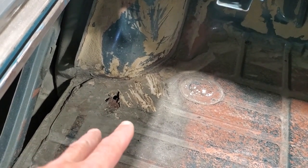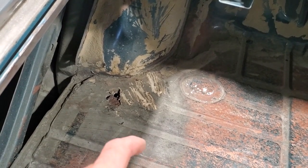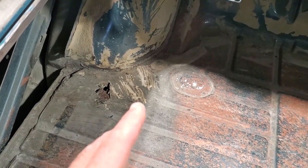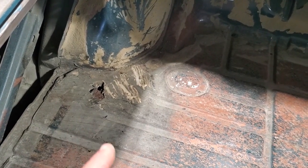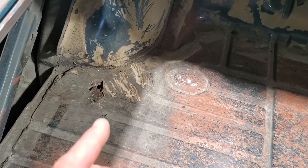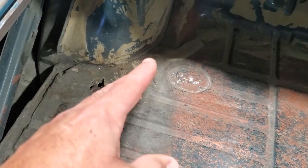You can find certain panels online, but my advice to you is anytime you come across a body panel that is not painted black and in the ad it shows it and it's bare metal, it's a homemade style panel, like it's hand formed, it's not done on a press. And usually the quality of them are really bad. You're just as well to go on and make your own piece.